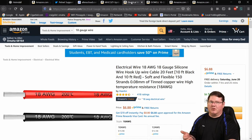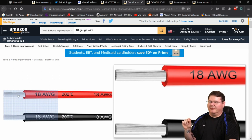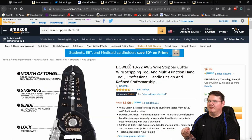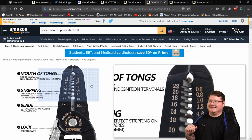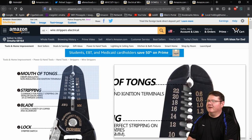If you don't have extra wire, the size of wire inside the PetNet feeder is actually 20 gauge — super tiny. I recommend 18 gauge wire; it's big enough, has more braids of metal fiber, and works fine alongside the 20 gauge. You'll need some extra pieces of wire, so if you don't have any lying around you can pick some up for about seven dollars. Because that wire is so small inside the device, I also recommend a pair of actual wire strippers — the wires inside are 0.8 millimeters, with only a couple of strands inside.